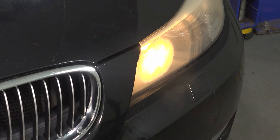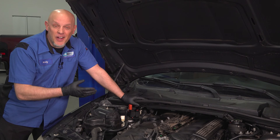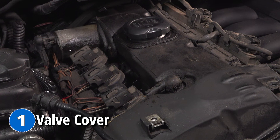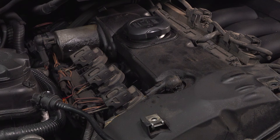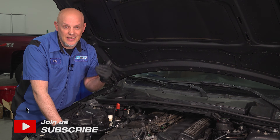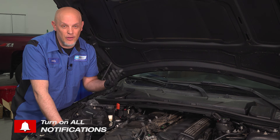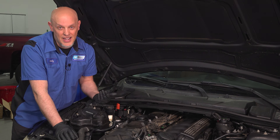It's never a good sign when you see smoke pouring out from under the hood. Let's start with number one: the valve cover. These valve covers from the factory are plastic, and that's great for weight reduction. Unfortunately, with the heating and cooling of the engine over time, the plastic gets brittle and will crack. When it cracks, it's going to leak oil onto the exhaust, and that's where you're going to get your smoke.